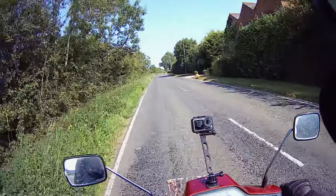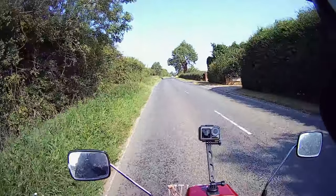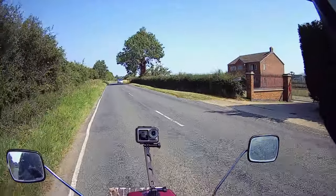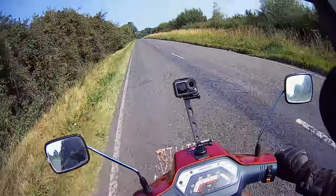Look at that. I've not done anything to it other than pump up the tyres and charge the battery. The interesting test will be to leave the battery for a day and see if it fires up all right the next day. If so, that's fine, because I can put it on a trickle charger and never worry about it going low again. So my conclusion quite clearly is, the old lady, bless her, struggled to kickstart it. She let her battery run flat, and that's the reason why. She didn't mention the speedo, so I'm hoping that might just be a wiggle.